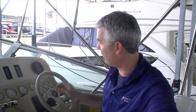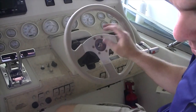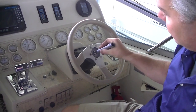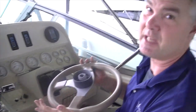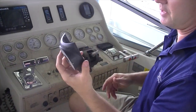The first thing you got to do is get the steering wheel off. I've already pulled the nut off and tapped the end to get it loose. What I did is I used an extension — you don't want to damage the threads. You just put it on here and tap gently with a hammer to get it to pop off, because it's a tapered fit so it's going to be on there kind of tough.